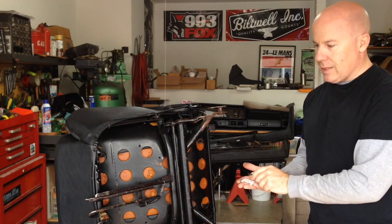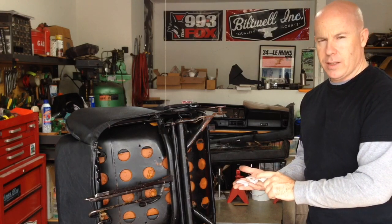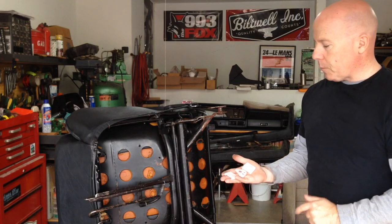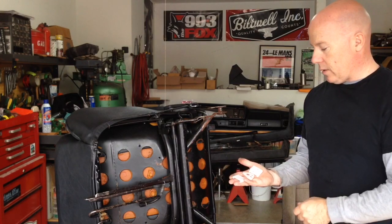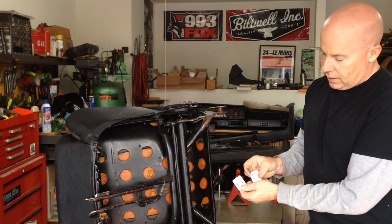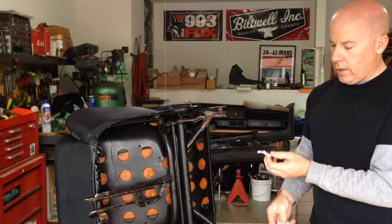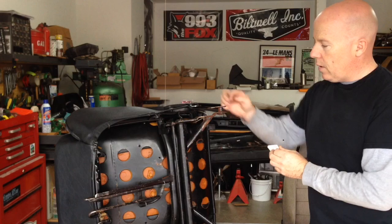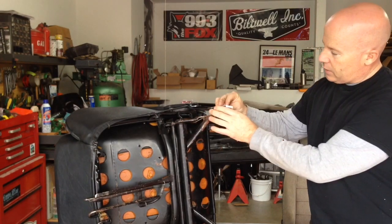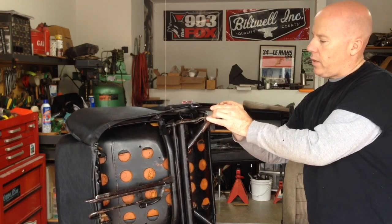In this car it uses this older style, which I think is similar to the air-cooled Beetles. I'll show you how these install. You can see the two side pieces — this one has a little bit of a tab, so that goes towards the door. They're quite easy to install. There's a little slot here and it basically just slides on like this. You just have to lift that up as you're sliding it on.